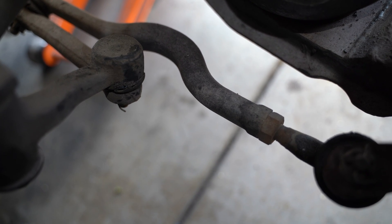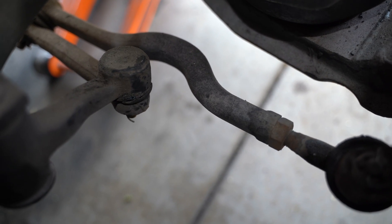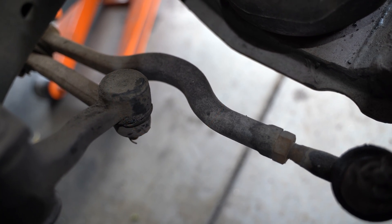Unfortunately on the Mighty Max, I cannot shorten the tie rod for two reasons. One, the tie rod is cast steel and I refuse to weld cast steel. Two, this little fancy bend in the tie rod makes shortening it as much as I need to impossible. It's looking like shortening the control arms is not going to be as easy as I thought. Not to mention the control arms on these trucks are borderline too short as it is for air suspension.